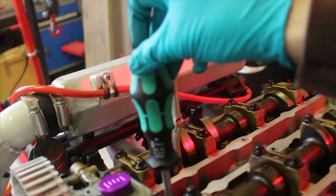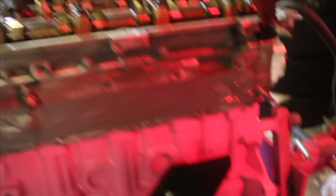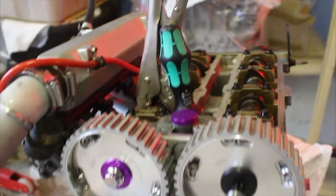We're just doing the cam timing now. We've got the lock-in plate in the back there — once you've spun the cams round, they've got these notches, which means you can slip the plate in and know the cams are perfectly parallel as they need to be. Cylinders at TDC, right at the top, and you've got the little locking pin that goes in the block and hits onto the web of the crankshaft. Now we've just got to wrap the belt round.